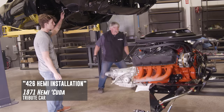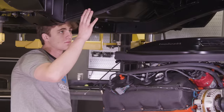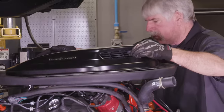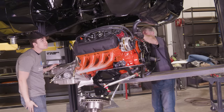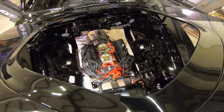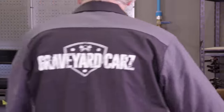Mark came and got Hunter and me to help with the installation of the drivetrain in this car — and this is really good experience for Hunter to learn how to install these. I was really hoping we could leave the shaker on there, but it's just too tight between those fender wells and the aprons. So I had Doug take it off so we could get the thing installed. I thought this was going to be a really tight fit with a lot of wiggling, but it went in with hardly any interference at all — what a miracle. Once we get the Magnum Force K-member up against the frame rails, we align it and put in the four bolts and the rest of the hardware.